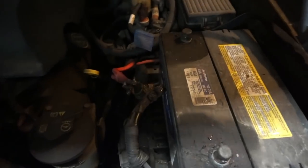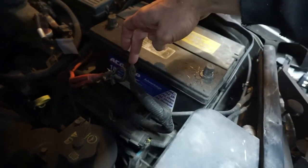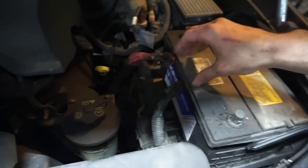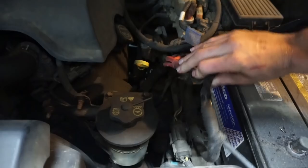Alright, that's it for this one. What I did there was pull that center plug out and make sure there wasn't any excess draining out. I think I actually need to put about another quarter to half quart in there — what I want to see is a stream coming out and then the stream stopping, so I know it was overfull and then gets to the right point. Right now what I'm doing is resetting the PCM — I'm taking the positive and negative leads and touching those together for about 15 minutes to reset the computer. Then I'll take it for a drive and let it relearn all the shift points and all that. We'll do that in another video — thanks for watching, have a good one.